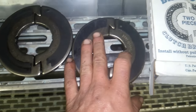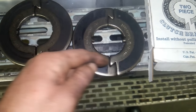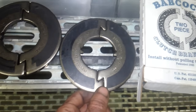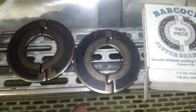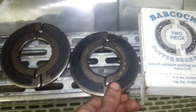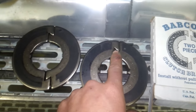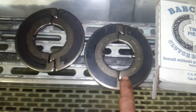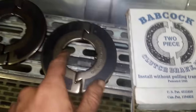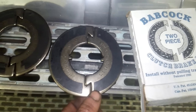There are a couple different types of two-piece clutch brakes. There's a style hinged on one end with a button and roll pin that presses through the center — I do not like that style; I've seen them come apart too many times, with the clutch brake flying off the input shaft going down the road. There's also a hinged type with an allen set screw, which is okay. But I feel this is the best style — the Babcock two-piece clutch brake. All you need to know when ordering one is your input shaft size; other than that they're all the same and easy to find.